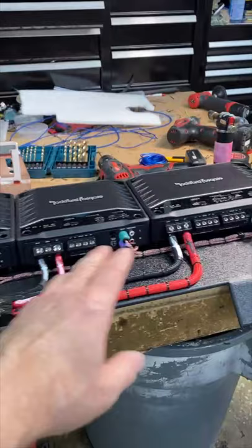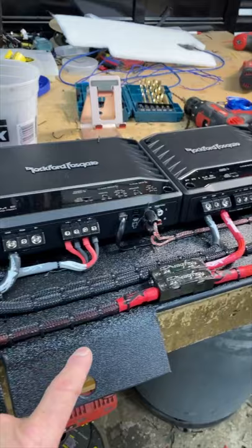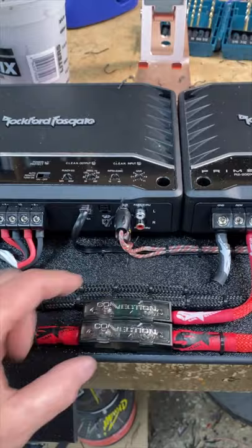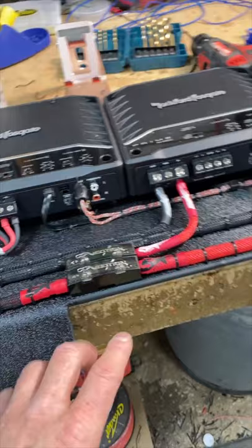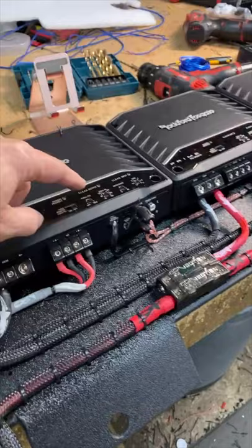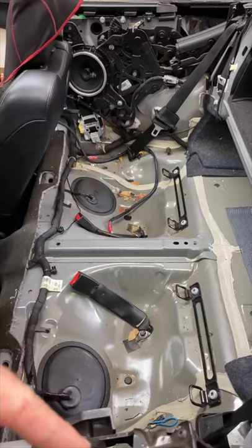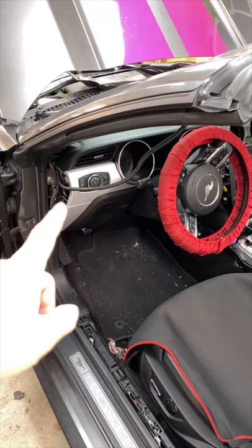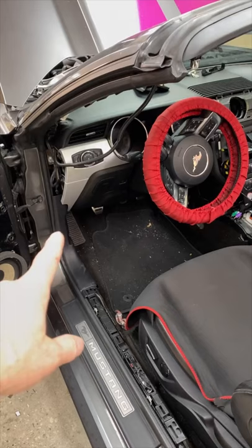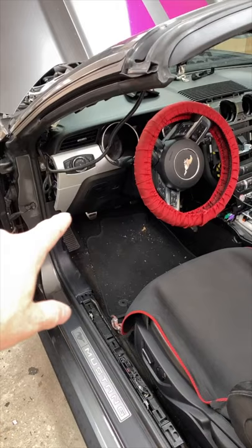The speaker wires still need to be run but power wires are done. There's a fuse distribution block for the two high amp amplifiers — simple, built however big you need. Power side, ground side, and remote turn-on go in. Speaker wires will come out of the amplifier — purple goes one way, green goes the other — wired up to the factory fit models in the back. After the wiring they need to grab at the factory amplifier location and mount both passive crossovers in that area. An iDataLink harness will go in to get all the speaker wires.